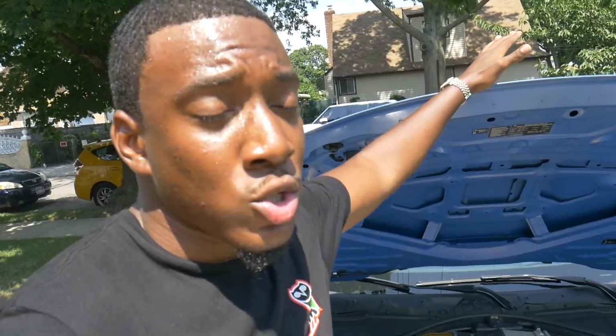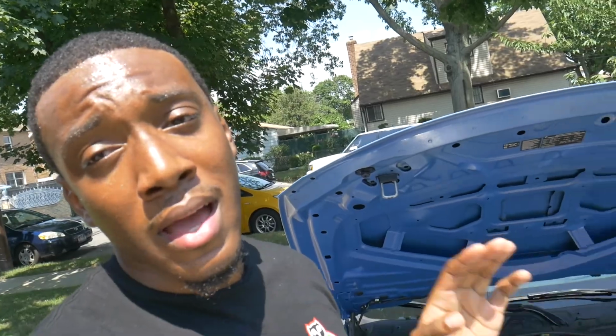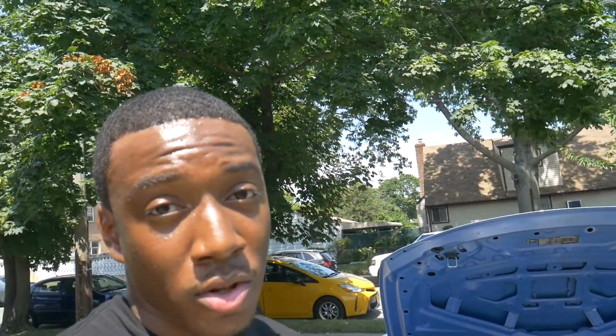They have true flex fuel for this car, so I can actually run a sensor and run whatever blend I actually want with the car, and the tune will adjust on the fly. Also, it comes with preset maps that my tuner can make and have uploaded, literally by just pressing a button on the steering wheel. So on-the-fly map switching is a big thing for me.